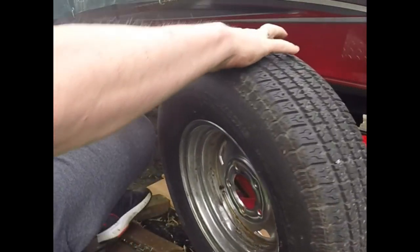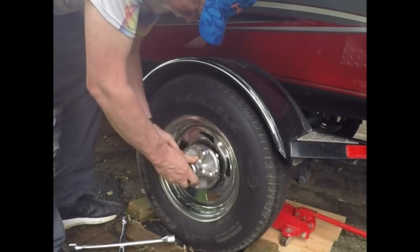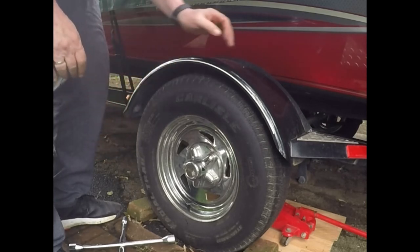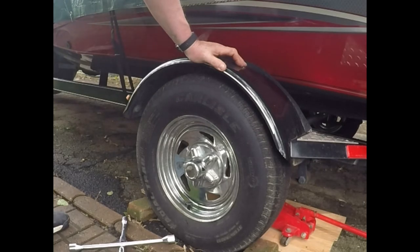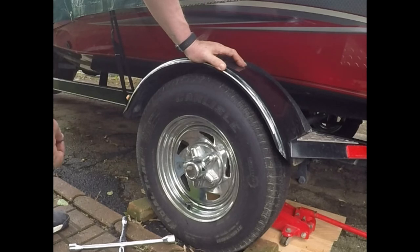Everything's clean here — there was no leakage from the back. All that's left is to put the dust cap cover back on, and it's all done. So that's what you do when you see grease on the outside of the wheel: check for the dust cap to have popped off. On our last trip it was pretty warm out, the grease heated up, expanded, and created a little opening which allowed the grease to ooze out. This is John from L&B Fishing Club — hope this has been helpful. We'll certainly try to make additional videos with tips and ways to make your ride safer and have more fun on the water. Tight lines!